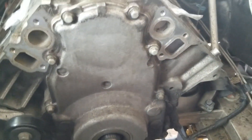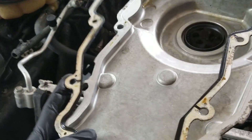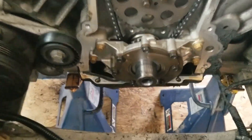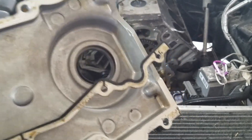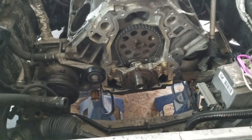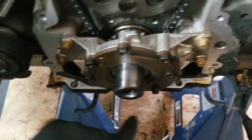It's just 10mm bolts right there. I was trying to figure out how to show this to you — whether to show it while it's still mounted or not. But there are 10 bolts. You can see two, four, six, eight — the eight from here are highly visible. But what you don't see are these two from the bottom, which are in the mounting points. You're going to have to get underneath the car and unscrew those two to get this entire cover off. The bottom pieces were just completely covered in oil, so there's really not much I could have done to show you where those bolts were. But I think you get the picture — you can see the hole right there and the other hole right there. That one and that one.